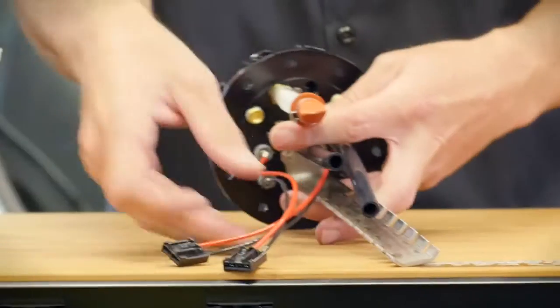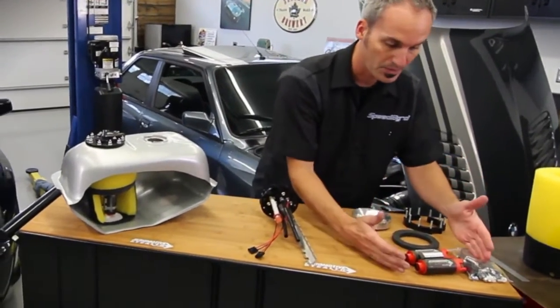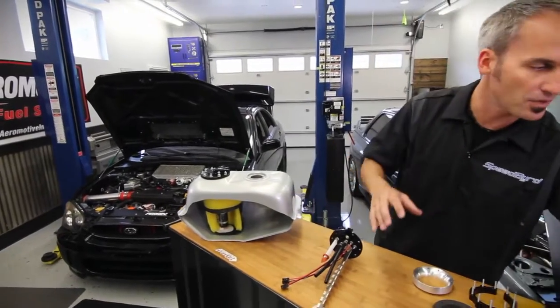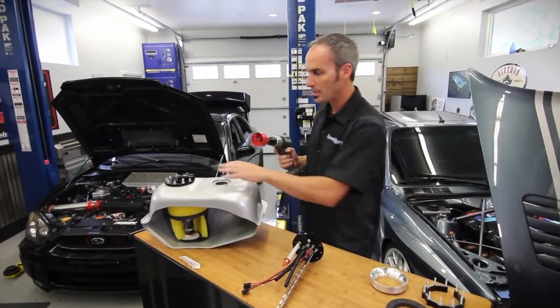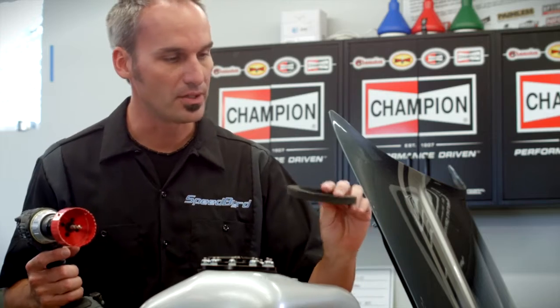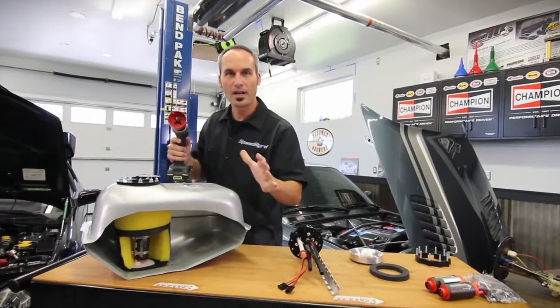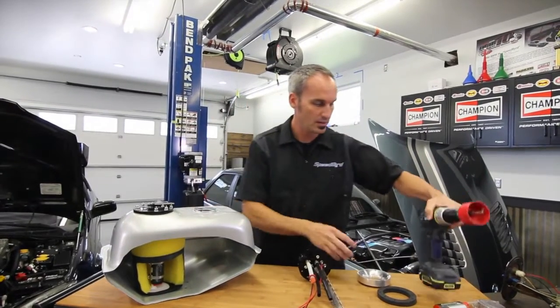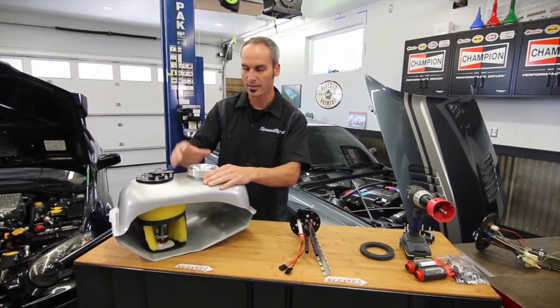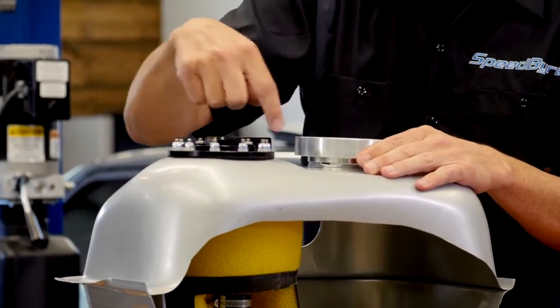At the heart of the system, obviously, is the pumps. You can start with a 200 or do a 340, run two 340s for twice the flow, or even get it for flex fuel if you're running E85. What's really magical about this system is you don't have to do any welding or major fabrication. The right diameter hole saw, scan over your tank for a spot deep enough for your module to sit in. This amazing gasket system — you can see how much crushability it has — can go over uneven surfaces with no problem and still seal. Once you've got your spot, a hole saw, punch out the hole. You can use this guiding tool — basically a guide for a lot of the other operations — set it in your hole and use these hole locations to get your mounting pattern.